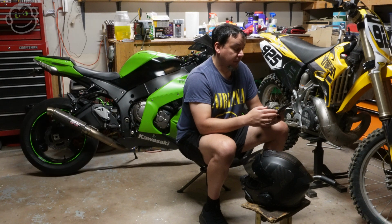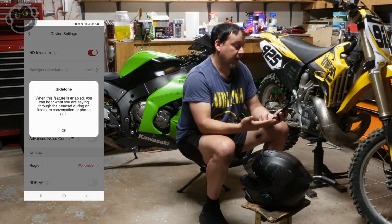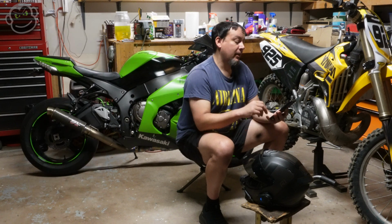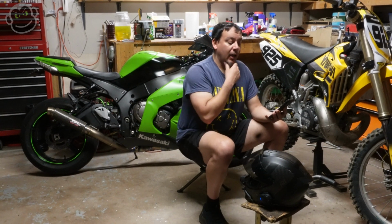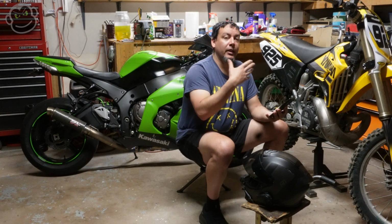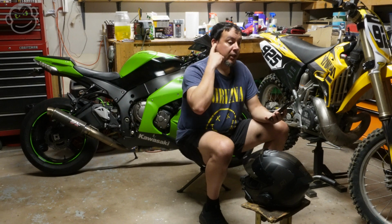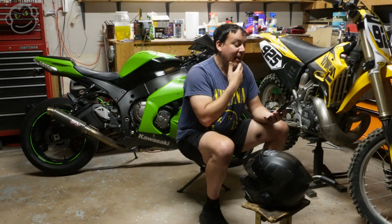And if you click the info, and I'm going to take another screenshot, you'll see that basically what it says is when this feature is enabled, you can hear what you are saying through the headset during an intercom conversation or a phone call. Now that's key. That's a key little detail. So what that means is with this feature on, anytime I talk, if I'm in an intercom session with another rider or I'm on a phone call, I will actually hear myself. It's going to route the mic input back out through the headset. So I'll be able to hear myself talking. Now that might sound like it's super annoying, but it's actually not that bad at all.